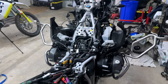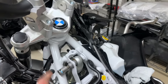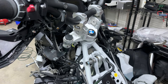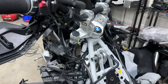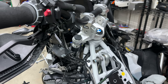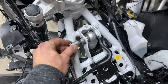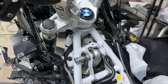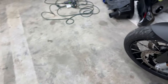So we're going to take a T50. People use the word 'permanent Loctite' — it's very intense thread locker used here because this is a structural element. This is a hard place because you don't have a lot of space to apply heat. My advice: use a breaker bar, a really quality Torx bit, make sure it's fully seated, take a mallet and hammer it into place. Turn it a little bit, and if you don't get movement, stop — don't let those Torx bits start to bend. The bottom bolt is the same bit size.